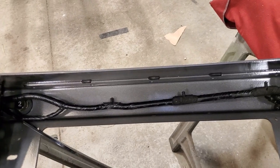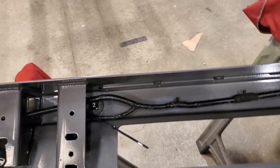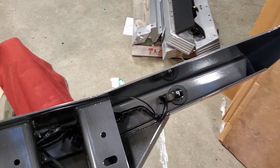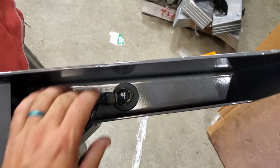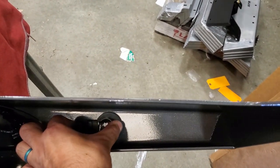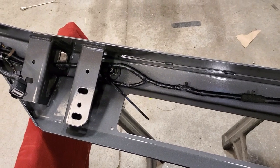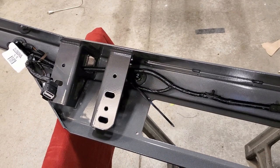We've had okay luck with swapping side to side for like the inners and the outers, but you don't want to put them in sideways, you don't want to put them in upside down, because of the area that they're looking at. It's not a big circle like you might think since they're a round sensor. They actually look in kind of a wide flat band. So if you have them put in crooked, upside down, whatever, you may get some false readings and have some annoying beeping going on when you shouldn't. So those are all in there now.